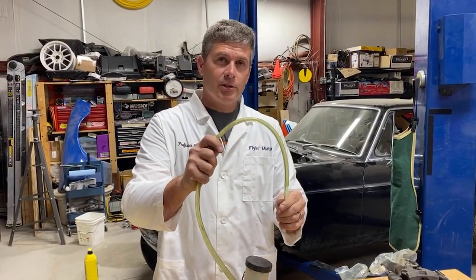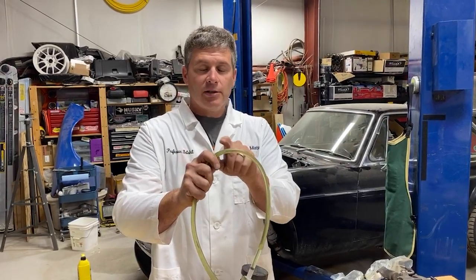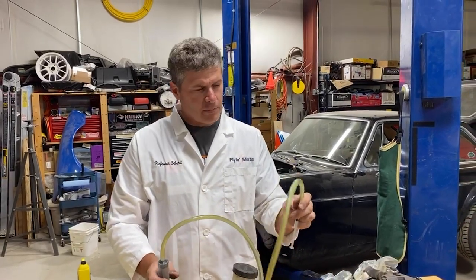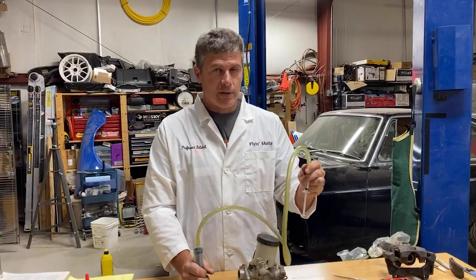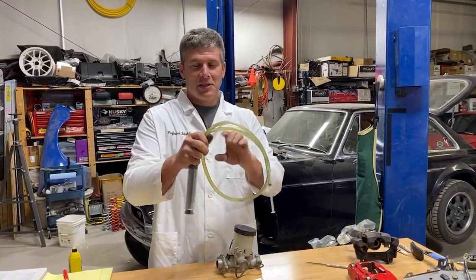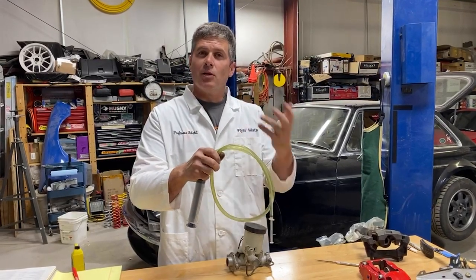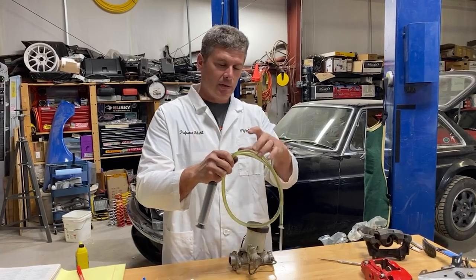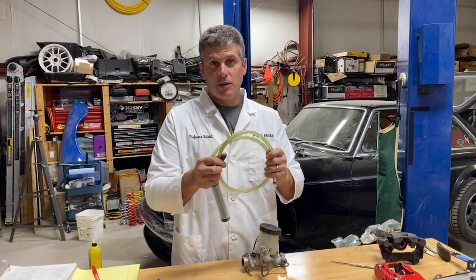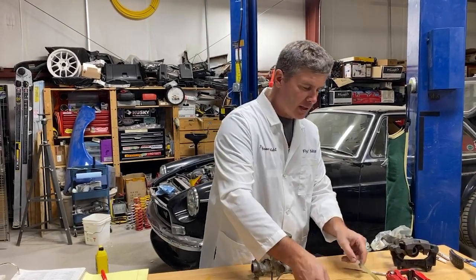That's why your brakes get squishy when you've overheated the fluid — you have to bleed those air pockets out. We also flush brake fluid regularly because it absorbs water out of the air. The more water it absorbs, the lower the temperature at which it boils, making it more likely you'll boil it and create air bubbles — then you discover at a bad time that your brakes don't work properly. If you have a soft or long pedal after overheating, that's your problem — bleed it out.